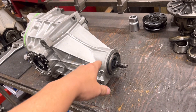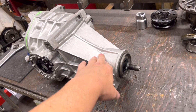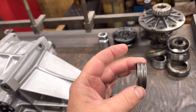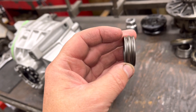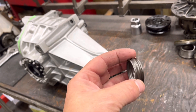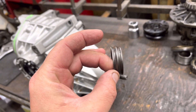I did go for the solid spacer on the pinion shaft. As you can see, this is the washer here. What I did — I didn't do the usual crush this down and measure it because I know these do spring back, so I think that's a little bit vague. I've probably done it a little bit more as an engineer would, whether it's the right way or the wrong way I don't know.